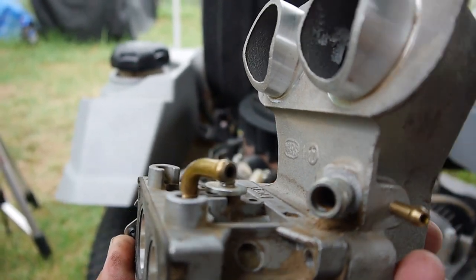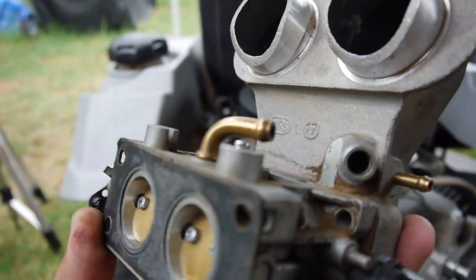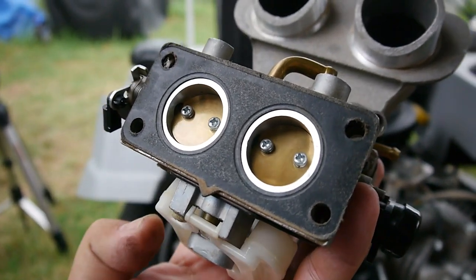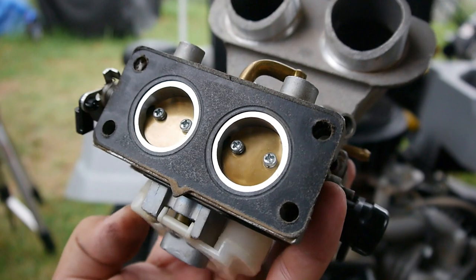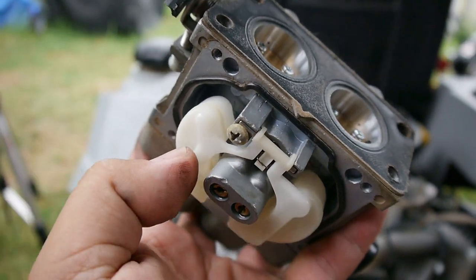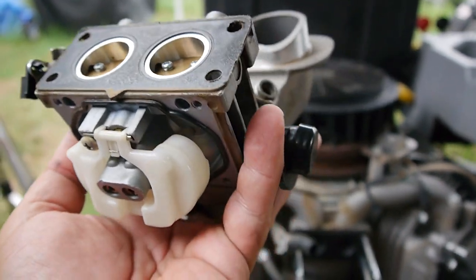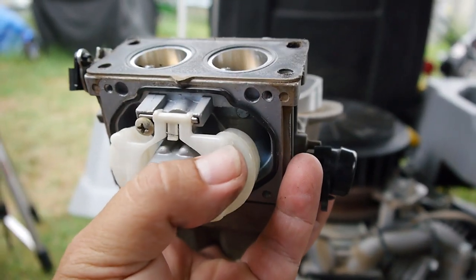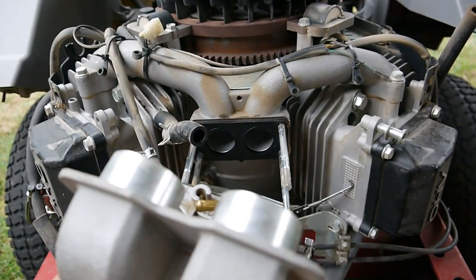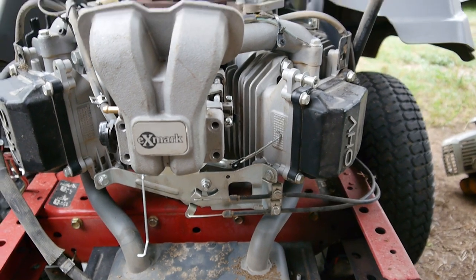It was never shutting off. I usually try to blow into the intake and work the bowl up and down to see if it's shutting off, but it's not doing it — it's like it's clogged. So this might be full of gas and the needle pin is stuck. I'm going to take that off, make sure it's all cleaned out. That was the biggest thing — you can see this thing is just full of gas, and hopefully that's the only problem, because it was just flooding gas all through this engine.